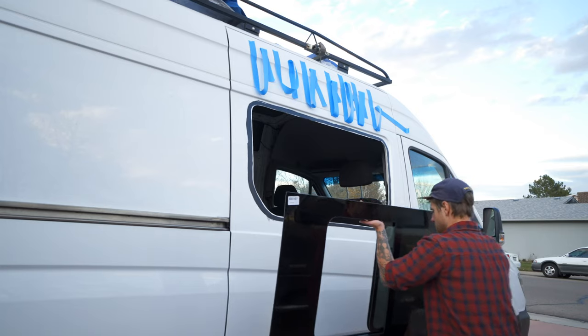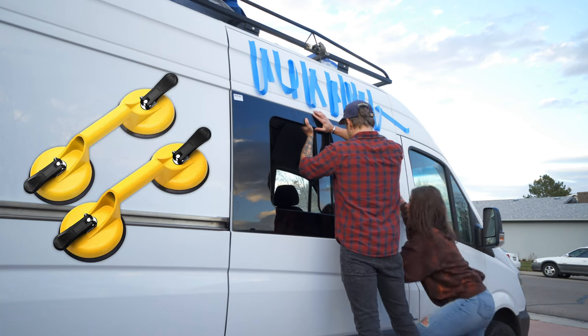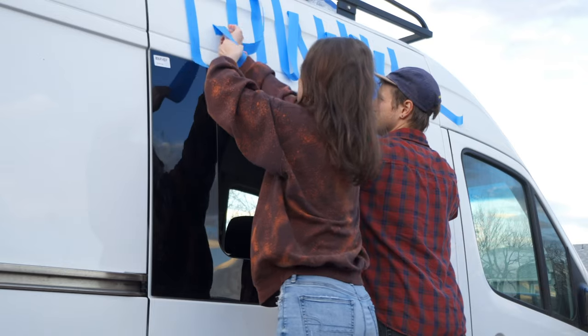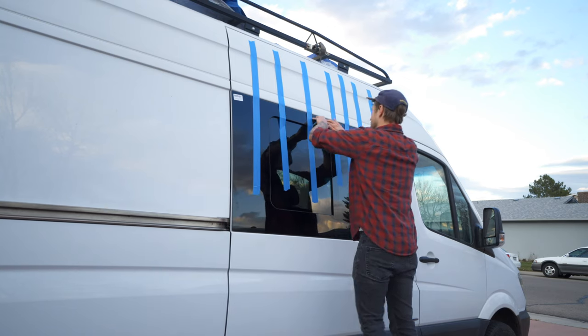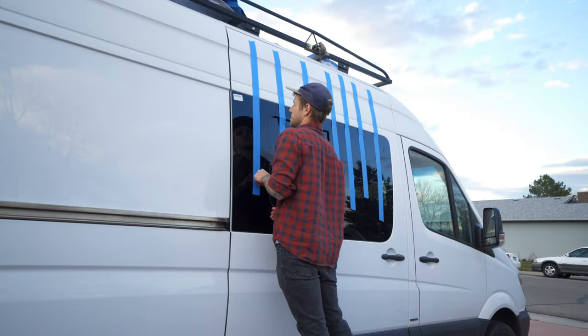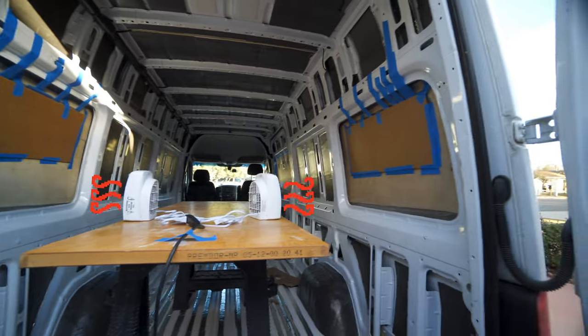Then it was time to put it in place. Since our window actually opens, we were able to put it into place without any special tools, but it may be easiest to pick up a set of suction cups to help you. We lined everything up, placed our tape, and then pressed along the entire perimeter to make sure we got a solid bond. Don't forget to put your tape on the outside to help support your window once you pop it in there until it's fully cured. The 3M window weld has a 24 hour cure time, but since it was getting pretty cold overnight we put our space heaters on the interior of the van, and just to be safe we let it sit for about two or three days.